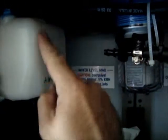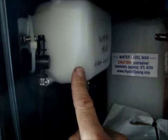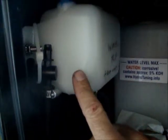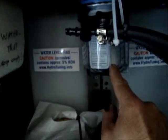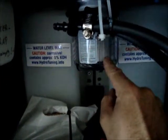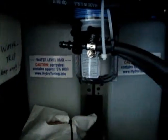Just in case there is a water overspill, it comes here into the water trap and the gas dryer. When you see water being built up here, simply take the nozzle off and release it outside the box into a bucket. The same here — when you see condensed water built up in the filter, simply unscrew the whole filter, dump it out, and put the filter back in.